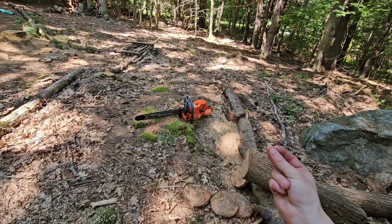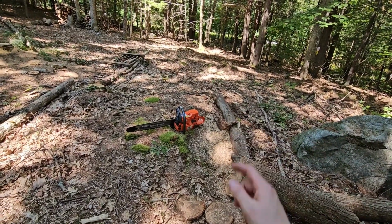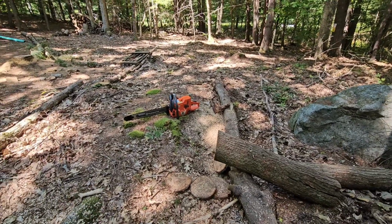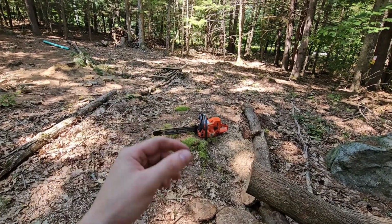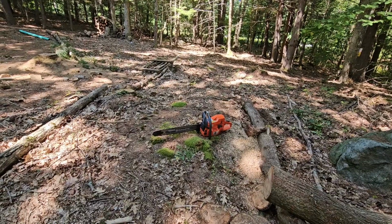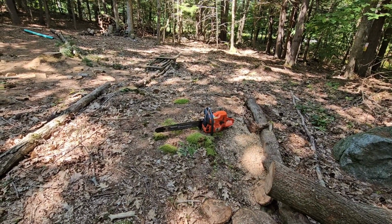And if you have good gas and you got spark and your saw is still running like shit and it's one of these, then you might want to swap it to an OEM carb like this one. Just know that you might have to do some extra priming with it. I literally took the top of the carburetor off, put gas in it, and put it back together. And now it's great. So, yeah, hopefully this helped you guys out.